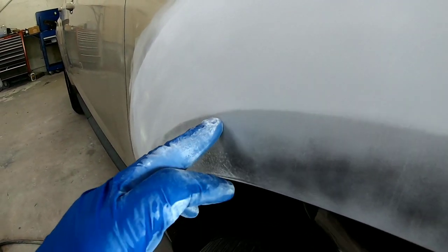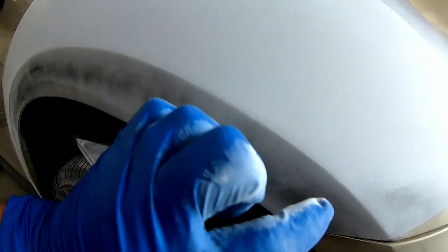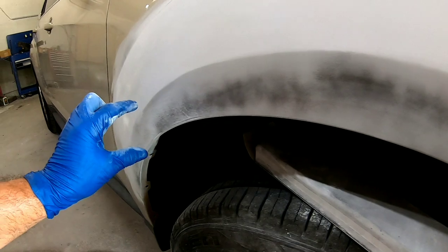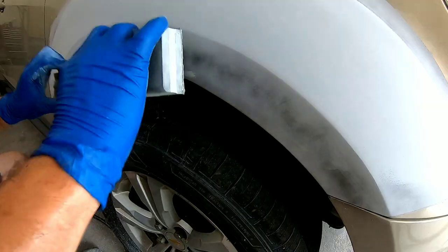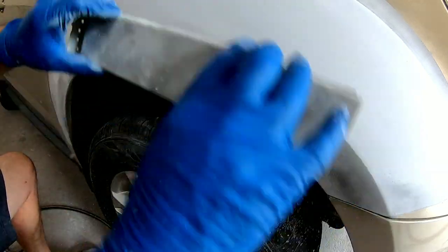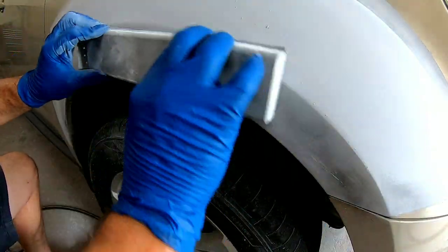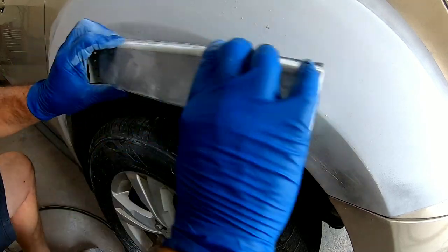There's a little bit of area here where we need to block just a little bit more, then we'll block this section to make sure it's straight and all the texture is removed. There are some reasonably priced tools you can use to mark out those body lines and use that line as a guide when you're blocking — I'll try and leave a link to those tools down in the description.